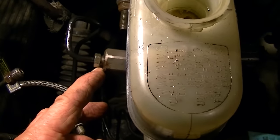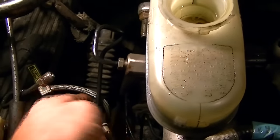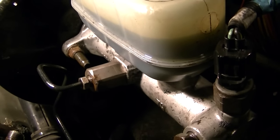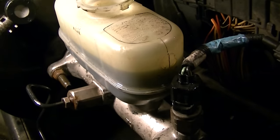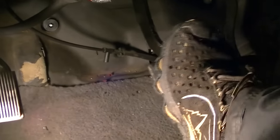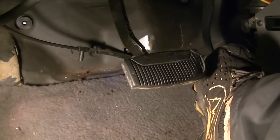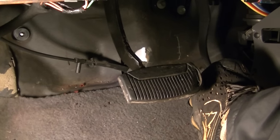The first thing I did was unhook one of the brake lines on the master cylinder that went down to the ABS — it was the same fitting, so I just unscrewed it. I wanted to route the system to sort of block it off; I just routed one hose back into the bottom of the system. I figured if I do that and push on the pedal, I should get a hard pedal — that would tell me the master cylinder is working just fine. Wouldn't you know, after about five or six pumps the pedal went hard as a rock.